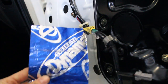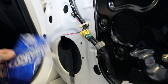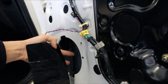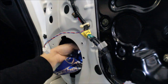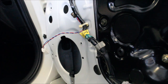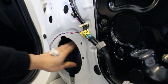The first product we're going to use is Dynamat Superlight. It's not the most effective sound deadener on the market, but as the name implies, it's very light and very thin. This is what we're going to use on the outer skin inside of the door. I've cut them into little pieces and it's really easy to work with. We've lightly cleaned up the surface in here. You pick your spots and apply it everywhere you can, wherever your hand really fits. We lay it out by hand and then go in with our roller, because the more you apply this to the surface the more effective it will be.